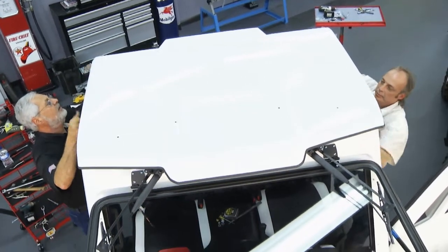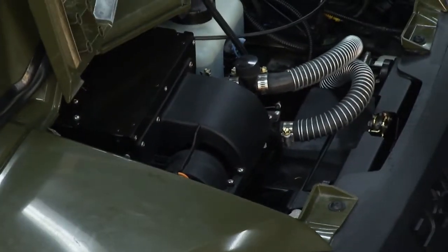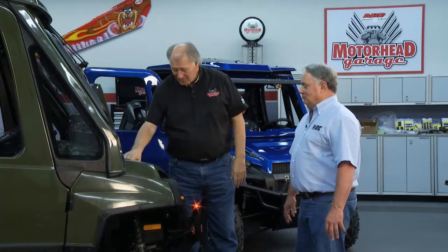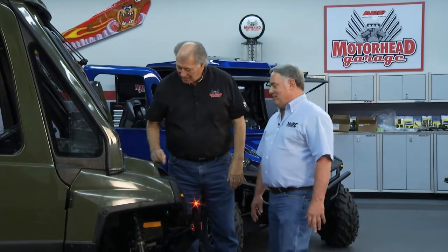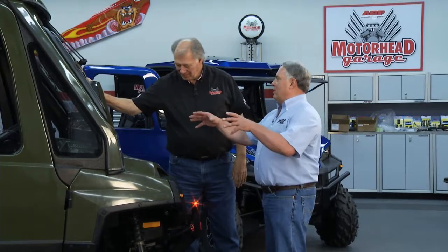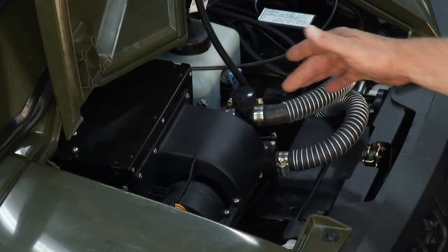Set this right here. The outside. That's pretty simple. Yep. Hey, you know, we were talking about the heater and the little Ranger. Well, you couldn't see it very well there, but by George, you can right here. Rick, this is pretty cool right in here. This is a nice compact unit there. We've installed it like an automotive style heater, so you've got defrost vents and you've got lower vents, and it's a hydronic heater off the liquid cooling of the engine, and you've got a heater control valve right there. Makes it a lot easier to get to as well.